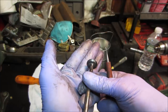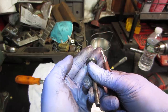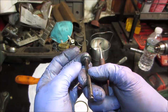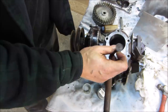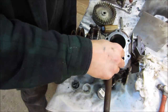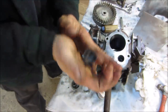Because the valve is rotating all the time, it can have an area that fits well, it's keyed well, and as it rotates it doesn't fit as well. In other words, you catch at the edge of the groove in one spot. We're going to go lap that one back in. That's way too much. Lick it and stick it. Hopefully it'll hold. That's what we're so afraid of.